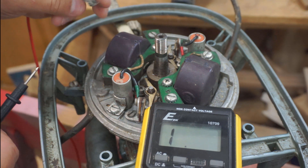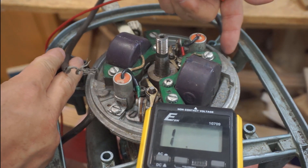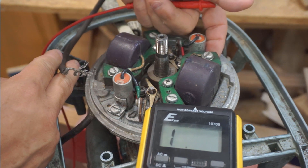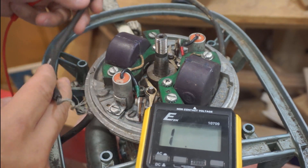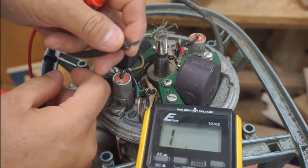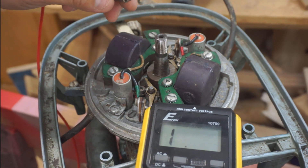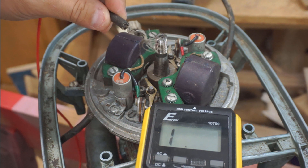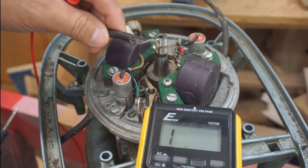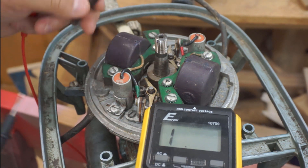I probably should have checked the wire first, because of the rubber and everything. It turned out the issue was inside where the wire connects into the ignition coil — it just didn't have a good connection. I should have cut it and reset it. I ended up taking the wire out, and this end was corroded too. So I pulled it off, cut the boot off, pulled out an extra wire, wrapped it around the ignition coil, and did some tests — the wire was getting spark. So it was the wire. This morning I went and got some more wire, and we're going to replace it now, put it back together, and test it for spark.